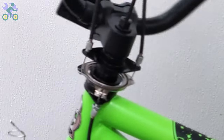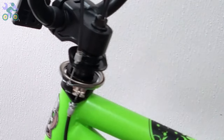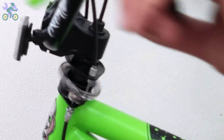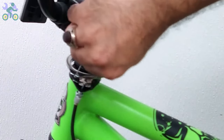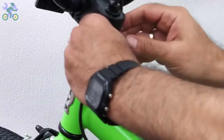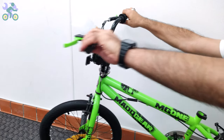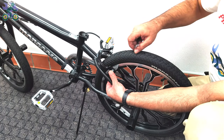Move the handlebar left and right. If you hear a clicking sound, it indicates that the upper brake plate is not properly aligned. To eliminate the clicking sound, increase or decrease the length of one of the adjustment barrels on the top plate to achieve the desired alignment. In another way, if you move one of the adjustment barrels, the sound will be lower or louder, and it will help you know in which direction to move the adjustment barrels. Perform pad adjustment and other necessary steps for the rear brake.